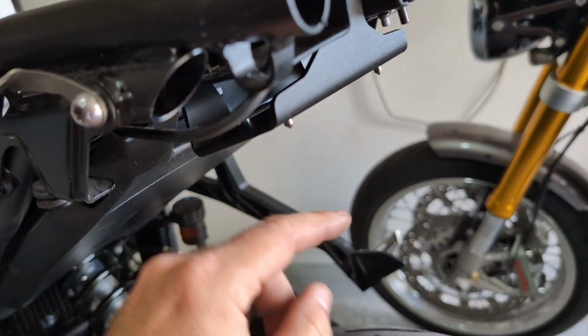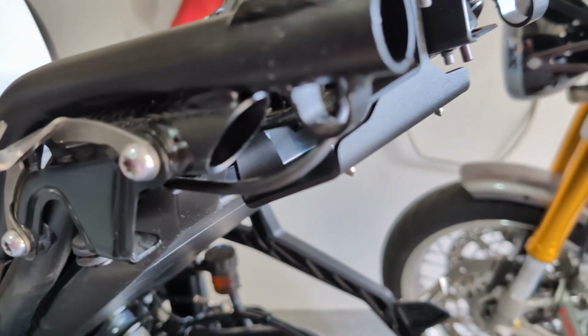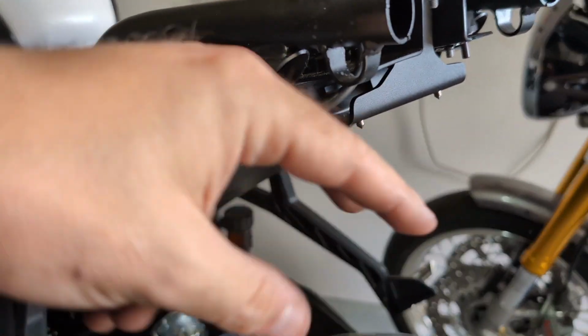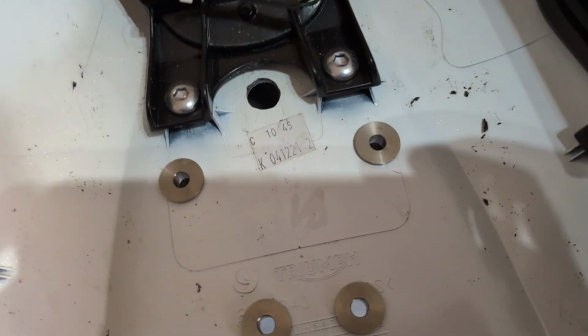And then what you do is you take the white fender piece there, slide that back on, and then pop it up to create divots in the plastic so you know exactly where to drill this pattern on that plastic. Pretty cool. So I'm gonna slide that on, pop it, pull it back off, recognize the divots, and then drill the holes in.